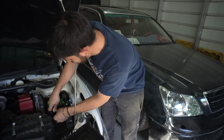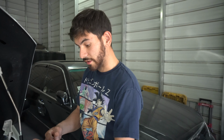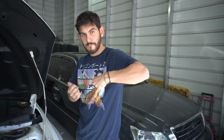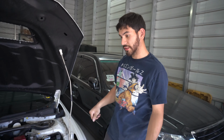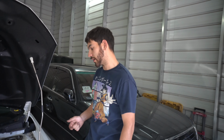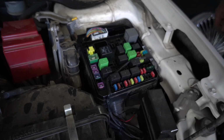So he was rolling into a show and his exhaust pipe is right on his drive shaft, like inches, like centimeters apart. He hit a bump and it knocked them together and bashed in his O2 sensor. He went to replace the O2 sensor and the car still doesn't turn on. For whatever reason, he feels like his ECU is bricked, but I think it could be a fuse or something. So I'm gonna check all the fuses real quick before he goes and tries to get a new ECU. Damn, that sucks.